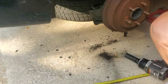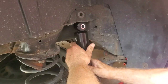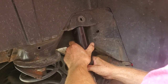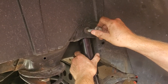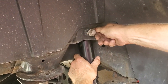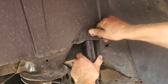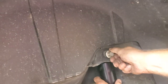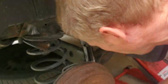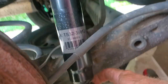So that's the old shock out. This part is easy — we just put the new shock in. The same bolt goes on top. All I'm going to do is screw it in finger tight, just to make sure everything's lined up. If you don't put it in at all the way, when you go to put the bottom one in, the top one is crooked and you'll mess it up. Can you guys see that down here? You can see how we're off by probably about three or four millimeters right here — see how it dropped down?